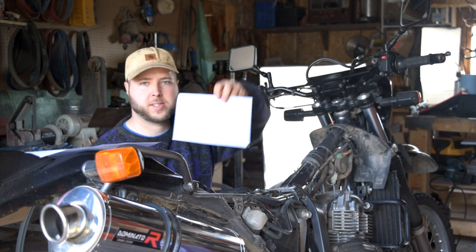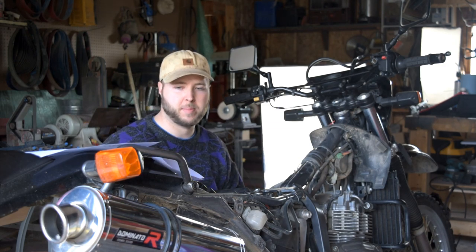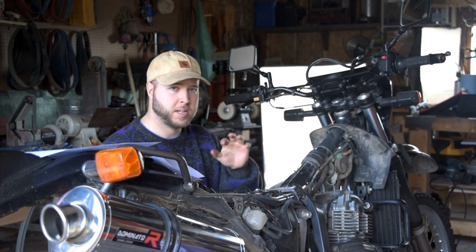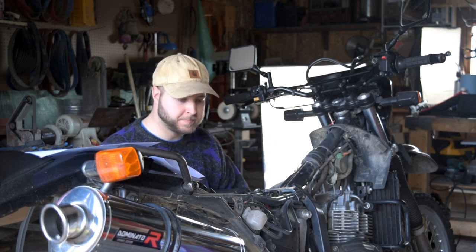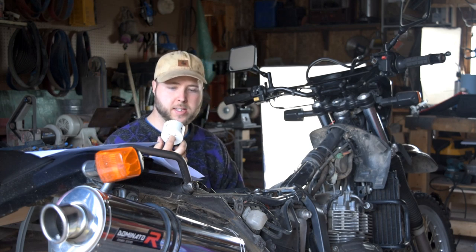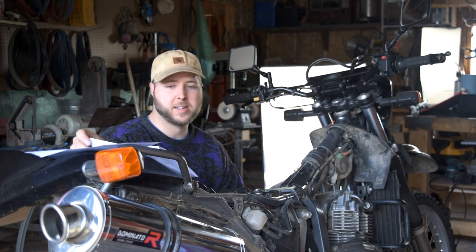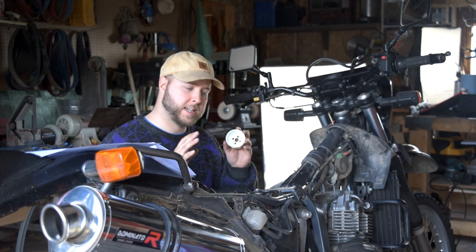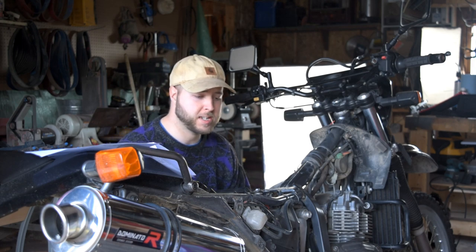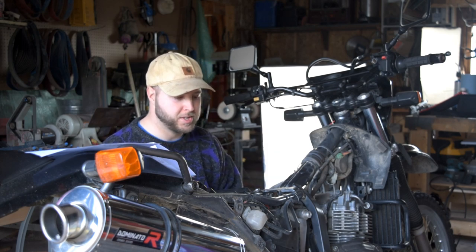ProCycle basically suggests you cut the top completely out of your airbox - they even gave a template that shows you how to cut out basically the entire top right off your airbox. I don't want to do that because my dad's has that done and it's going to be a little bit harder to cover over because of how much they went about it. What I'm going to do instead is punch a few holes. I understand that not everyone has hole saws like this, but I happen to have them. I'm going to cut roughly the same amount of real estate out of my airbox, but I'll do it strategically with some holes so that I can fill it later or close up some of that airbox if I need to. If you just cut the top right out of your box, you're not left with much options.